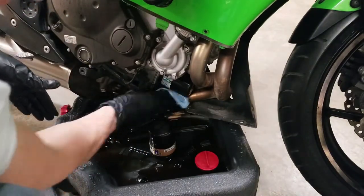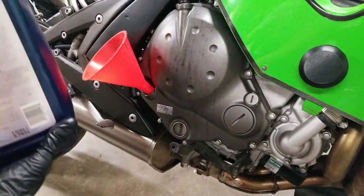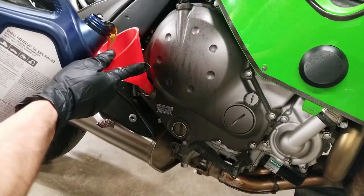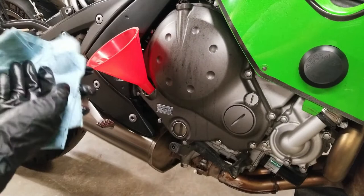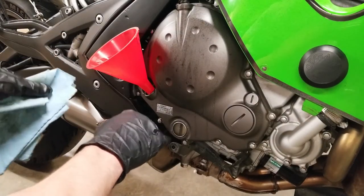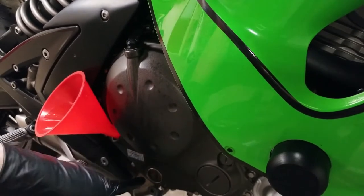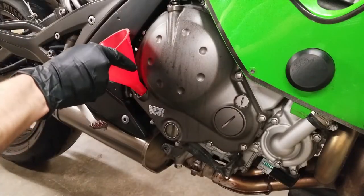Now I'm just going to wipe up all the oil while the catcher is still underneath it. I'm going to put the funnel at the fill hole and just start pouring the oil in. I'm going to be watching right here at the oil level — I'm going to wait until it gets to about almost the top and then stop. I can see the oil is at the very bottom, so I'm going to put it vertical just to see where the level ends up, because I don't want to fill it up too much. Once it's vertical, it's right at the very top, so I'm going to stop. This will fill up the oil filter when you start the bike, so I have it right at the top so it'll drop a tiny bit once the oil filter fills up.